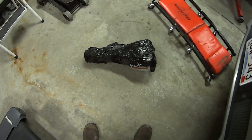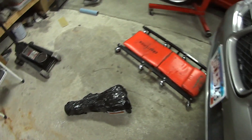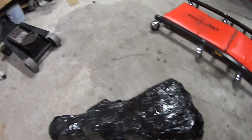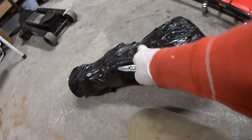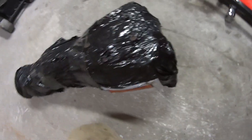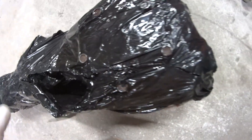Here is part of the puzzle I was waiting on — this is an R160 with a 3.9 final drive. Because I ran the 06 transmission in this, I had the 3.7 final drive. But this is what we'll need to retain the rear axles and hubs that came with the car. This shouldn't be anything special, it's just a junkyard R160. I'm hoping not to douse the shop in more gear oil — looks like I might be doing so, because it's wrapped up and looks a little greasy in there.